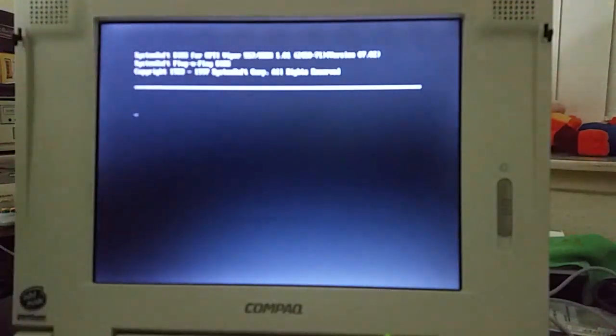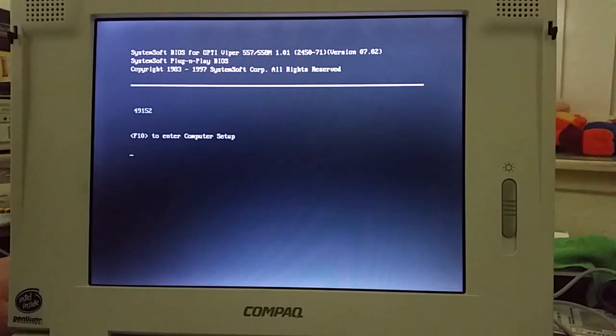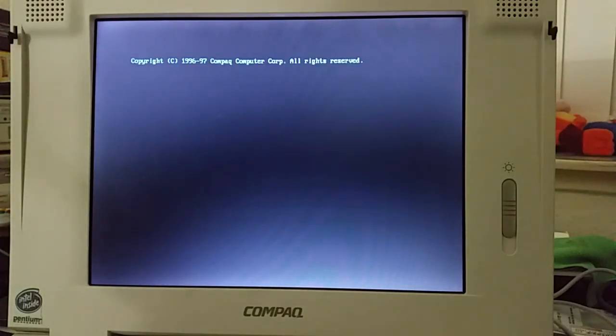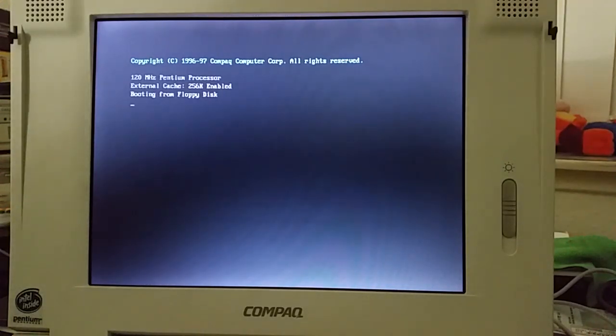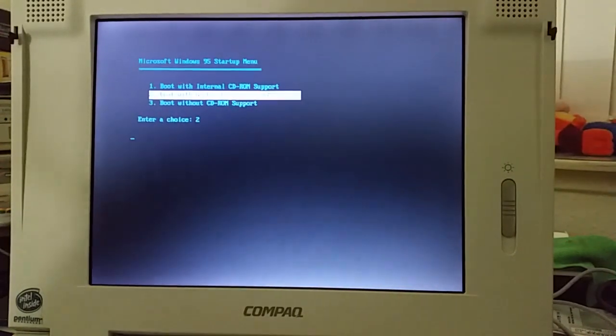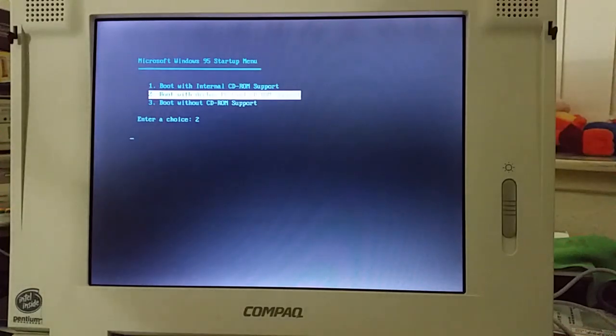This can happen with this particular machine. It needs to be able to power the drive off and then power it back on so it can reinitialize it, otherwise it just doesn't see it. It does seem a bit odd, but if I'm running with DOS and I've got Cardsoft installed, it usually takes charge, and then when the CD-ROM driver comes to load, it works every time. Okay, so computer science lesson over.